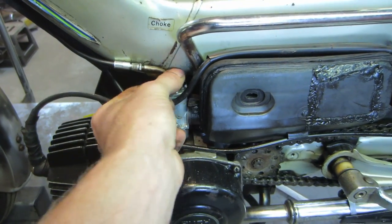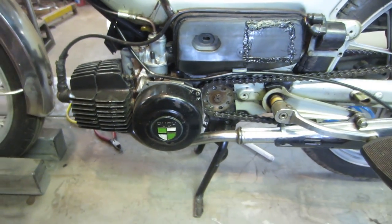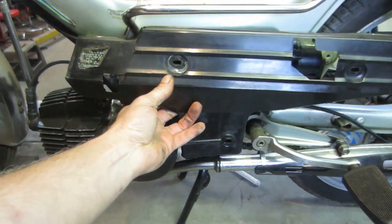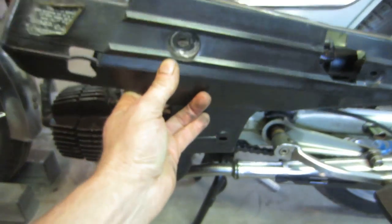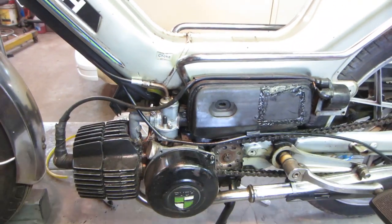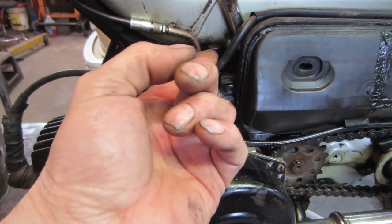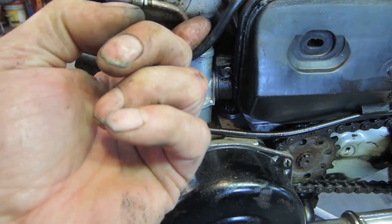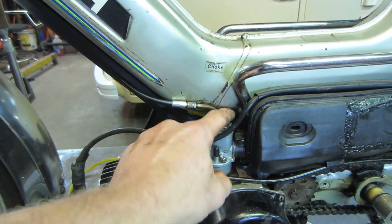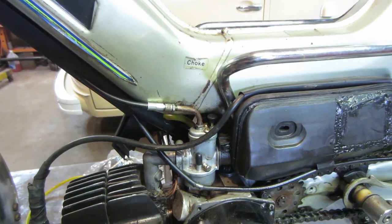You have to give that a little tweak and I'd be able to attach something to that so that I could function that choke, because when this cover is on there, where'd she go? Like that. Well, that's going to be a little rough to reach. So we have to make a little extension for that anyway. So maybe I don't want to pop that carburetor out of there, or maybe we'll take the button off the top and try to come up with something that extends that, even if I have to tack a little something on there. See what we come up with.